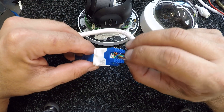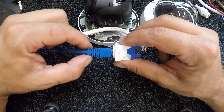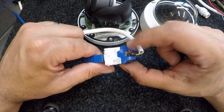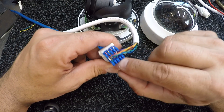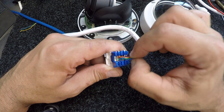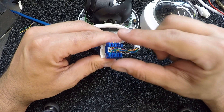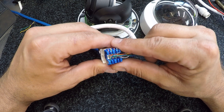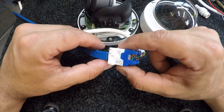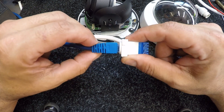This is a very simple fix that will get you out of a bind if you need to fix a camera and get it running again without access to a replacement. If it's in the right place it's going to work perfectly for as long as the camera wants to live. Do use a good quality mechanism — some of the cheaper mechs don't have contacts quite close enough together, and because this cable is multi-strand with insulation not designed for punch-down, cheaper no-name mechanisms don't always bite hard enough to perforate the insulation. Use a good quality mech punched down to the 568A or 568B pinout from the tech bulletin and your camera should be up and running for many years.